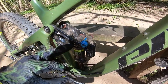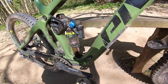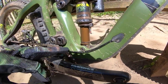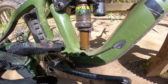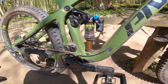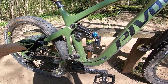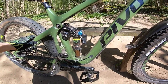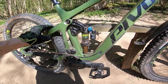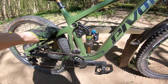There's a trunnion mount at the front with bearings through there for ultra sensitivity, and a nice sag marker to record travel. The shock is keen to use most of its travel and then often stops short of giving full stroke. I had to work around that with a volume spacer — dropping out the original quite large 0.6 inch volume spacer for something smaller, just to get a slightly less progressive stroke and get full travel out of it.